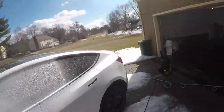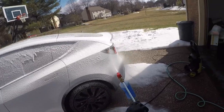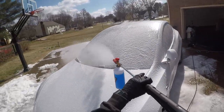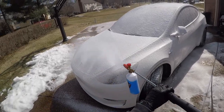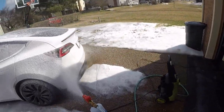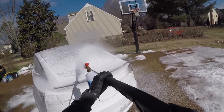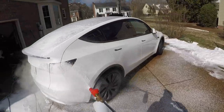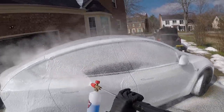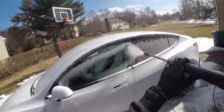This is one of those common things that trips beginners up. If you go on the market and try to find foam cannon soaps or agitation wash soaps, you're going to find washes and waxes and things that leave protective barriers. What we want is a soap that prepares the paint in a very specific way — it leaves no wax, no unnecessary solvents behind, no protection on the paint. We want a soap that is essentially going to strip the paint bare naked, so that when we're finished with the wash we don't have to go in and remove some sort of protective barrier or wax.